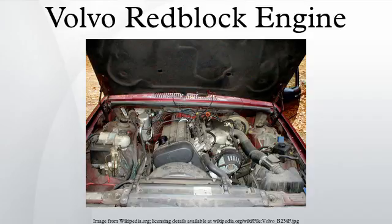The 2.0-litre turbo variant was introduced for European markets with tax structures tied to engine displacement, such as Italy. Unique to the B204 turbo was an exhaust gas pyrometer which was used to detect excessively high exhaust temperatures. When excessively high exhaust temperatures were detected, the fuel injection computer would richen the mixture. It has a forged crankshaft, cast pistons, and 13 mm connecting rods.